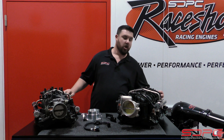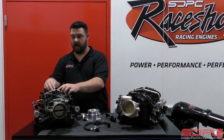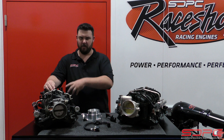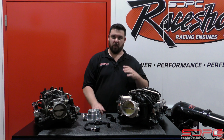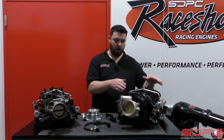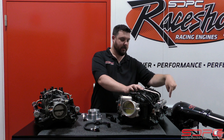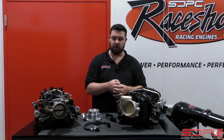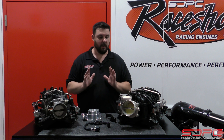The next thing is going to be your PCV hose. They're actually in the same location, kind of top and center here. The old intake had a nipple here for a rubber hose to go onto your driver's side valve cover in the rear where a PCV valve or an orifice tube would be. The new style intake uses a fancy O-ring sealed, all-plastic molded twist-lock hose. It has a nice little bend in it that clears everything nicely, but it will not connect to your other valve cover. Most guys just cut that off, put a nice little piece of hose on there, clamp it up. Another customization you have to do where there's no off-the-shelf part, but again, very easy.